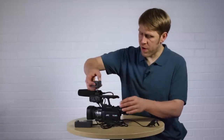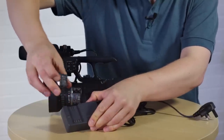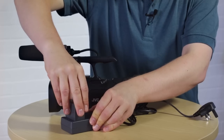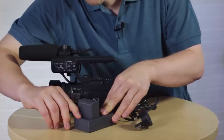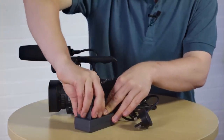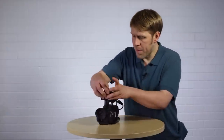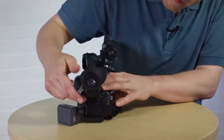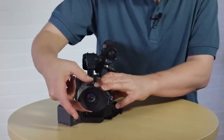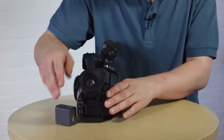Next we need to deal with the battery. The battery slots into the charge unit — line up the teeth with the metal contacts, then plug this end into the mains. When it's charging the green light should flash, and when it's fully charged it will stop flashing. A full charge should last about two hours of continuous recording time. To get the battery onto the back of the camera, pull the eyepiece out and lift it up — don't try to lift it up without pulling it out first because you might break the camera.